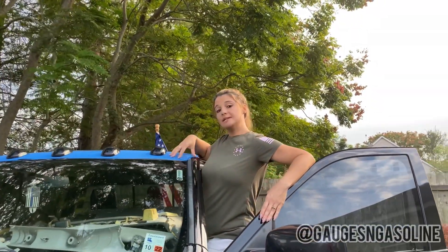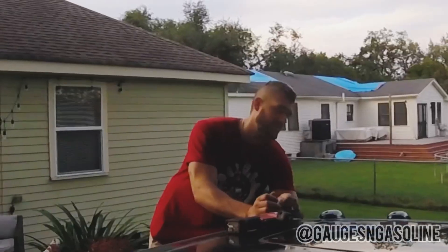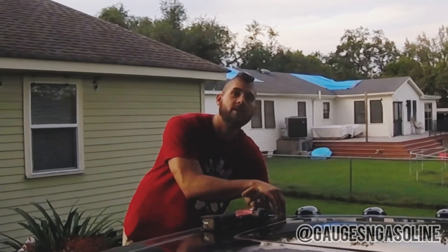You don't actually have to remove your whole headliner — you can partially remove it. I did it because I have a repair to make and it makes it easier to access when you're running your wires. Next, put some tape down and mark each light where you're going to be drilling into the roof. I already have my lights all marked out on my tape.